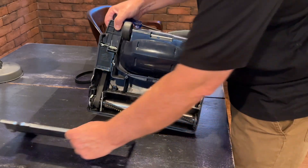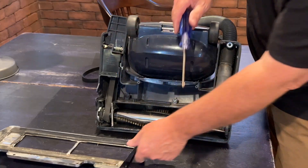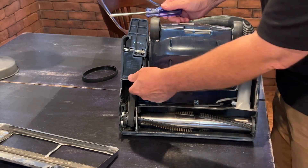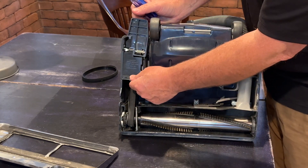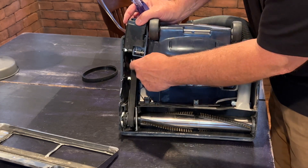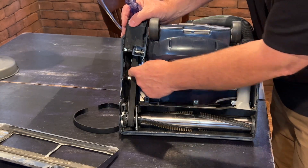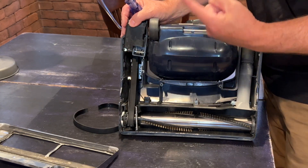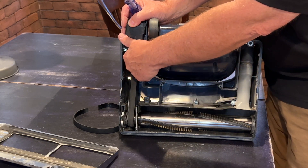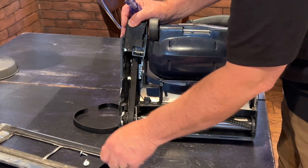You're going to pop the front cover off. It's got a little groove that holds it on, so you want to take it off and push it down. Here's the brush that goes in here. I already have a new belt on here — this is the belt drive where it goes. You'll pop it open and look in here; you're probably going to find a belt. What's making that smell is there's a pulley back here that drives, and as the belt comes off, that pulley just turns against the belt — that friction from the rubber is what you're smelling.